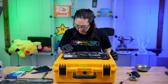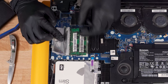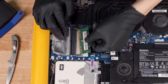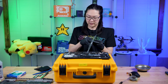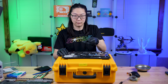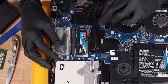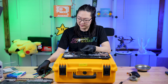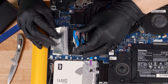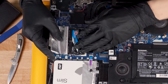That looks like a really spinning hard drive. To take laptop RAM out, it's pretty simple. Open it up right here — they go up like that. You pull these things to the side and then it comes out just like that. We're just going to go ahead and pop this new RAM in here — there's one and two. To put RAM in a laptop, you go in at a 30 degree angle and you push down, so it just goes in like that. Take both fingers, go to the edges, and push down just like that. Sometimes you might need to give it a little encouragement and push it in all the way.